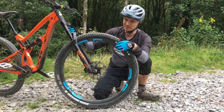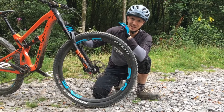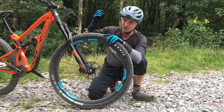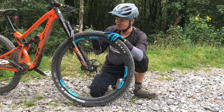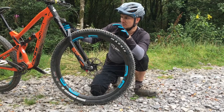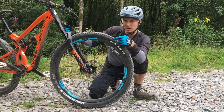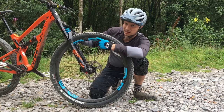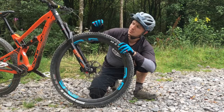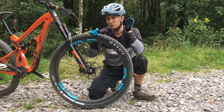The really interesting thing is something you probably can't see. The main problem with carbon wheels is that if you hit something really hard you can break the carbon, which you can also do with an alloy wheel — but alloy wheels don't cost a thousand quid per rim. They've got a lot invested in keeping these in one piece. You can either make the rim stronger, which makes it stiffer and harsher, but they've thought their way around this. What they're using is a very thin plastic strip around the rim, and in conjunction with a new redesigned bead, the actual bead itself is a little bit wider — about 4.5mm compared to the 3.5mm of most tubeless bead systems.